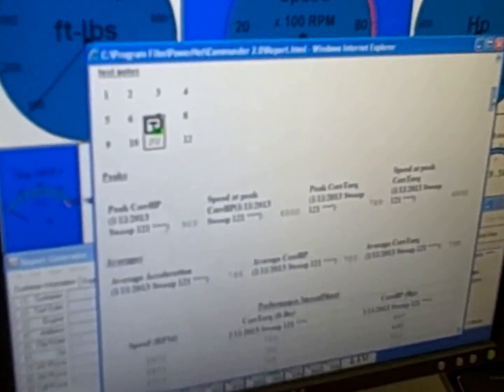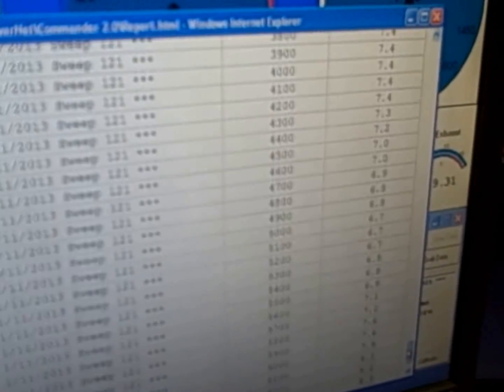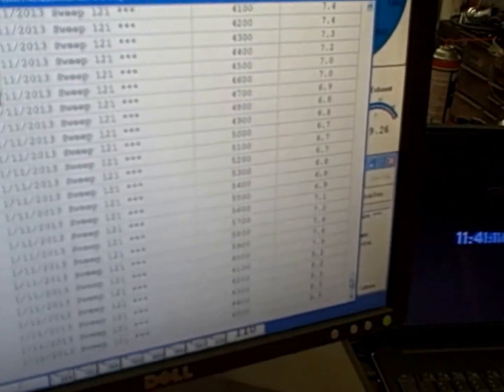Still need to go ahead and pull it down and slow the blower down some more, but still made 903 horsepower at 6,500 and 769 foot-pounds of torque at 4,500. Our boost level dropped about a pound and a half of boost with this pulley change.